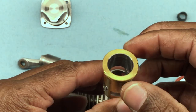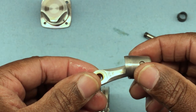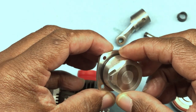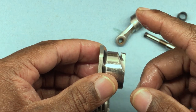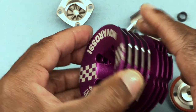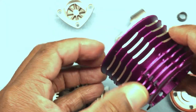I'll show you the exhaust side too. Man, I want to break this thing in so bad. Back to the intake side. The piston does have the dimple — that's a team edition piston, that's what they call it. It has the R7 rod in there. Back plate. Remember when you're taking this apart — put your piston at top dead center so you don't break your skirt off taking this off. Made in Italy head — it's pretty deep in there, so this is a low CG head. Not super low, but low CG. Purple head.